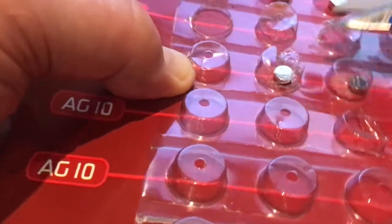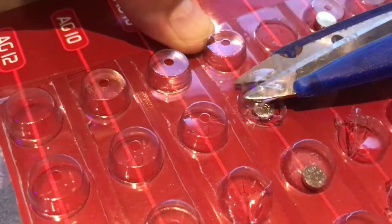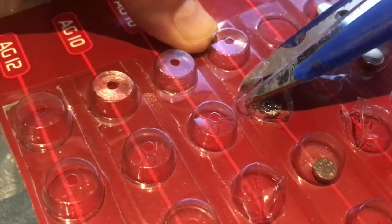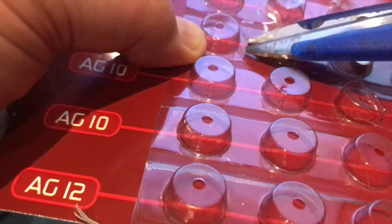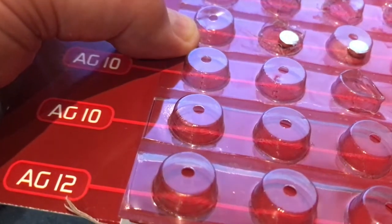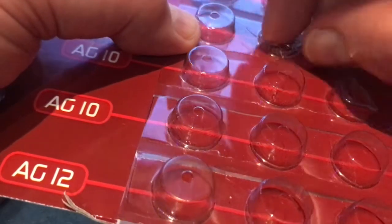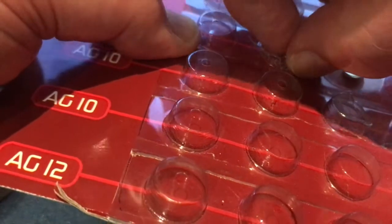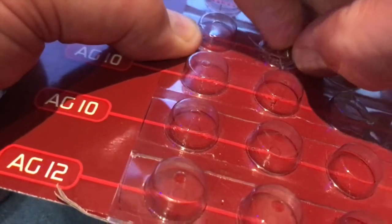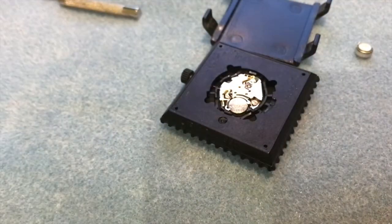The thing with these batteries — do not lose any. If a child or an animal eats one of these there is every chance they will die, because as they break open they release horrible alkaline chemicals which you really don't want to ingest. Okay, so now lift that battery out, place it somewhere safe, and make sure all the remaining batteries are still secure.